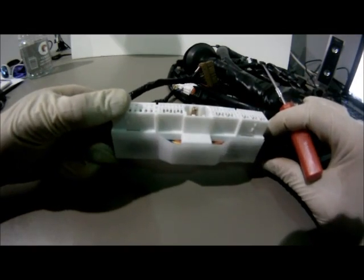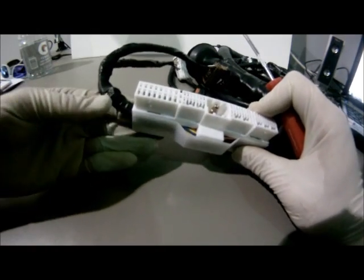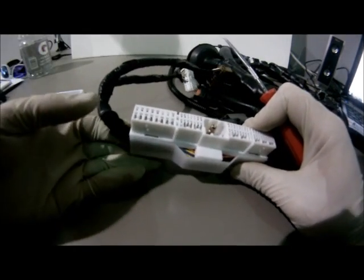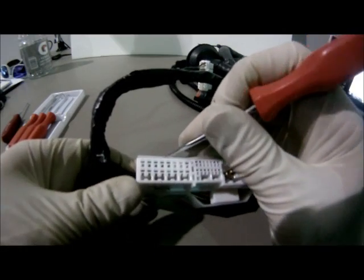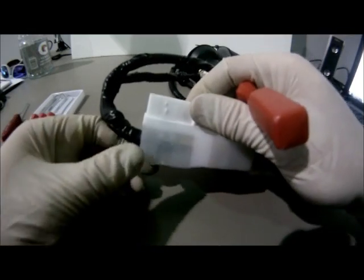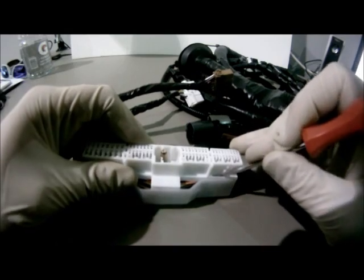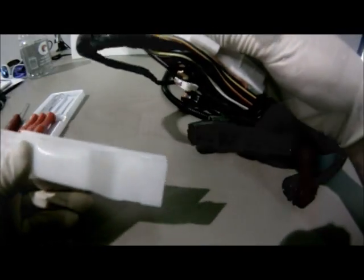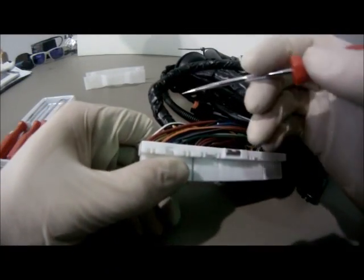On the harness is equipped with an OEM ECU connector as well as a dust cover. To begin, we are first going to need to remove the dust cover. To do so, use your finger to apply a small amount of tension on the outside of the dust cover, then using the picks pull the tabs off the top. The tension will help you to remove the dust cover. Repeat on the opposite side.